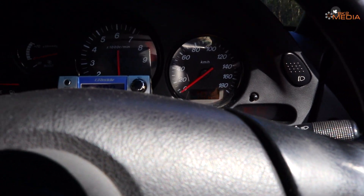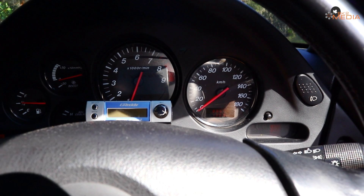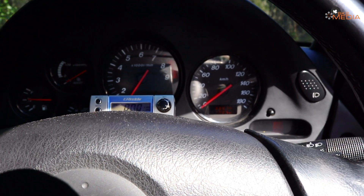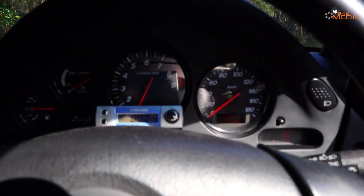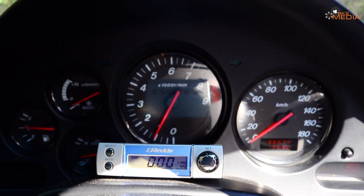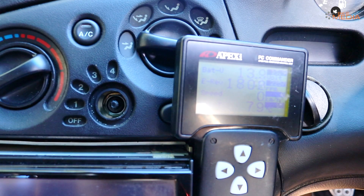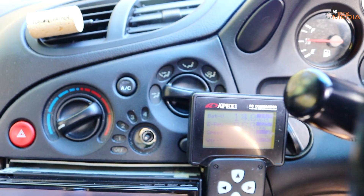It basically seems like it struggles — it'll turn off and then turn on again. You don't need to press the accelerator; the thing has to idle itself. Until it does, it won't run well. So that's something you have to keep in mind — very important. Now it's idling itself. I can rev it a little bit, and I've got my aftermarket Apexi computer showing temperature at 79, so I'm ready to go.